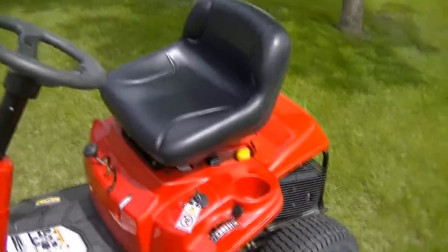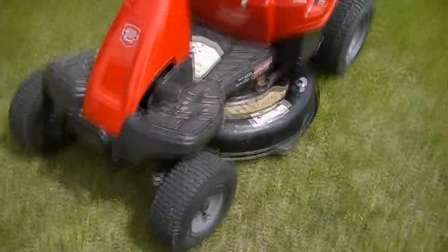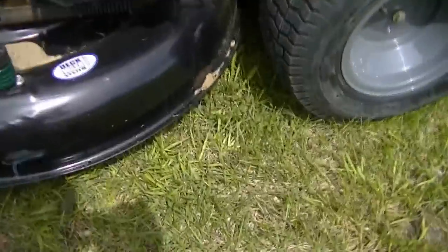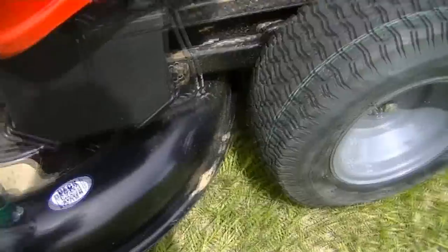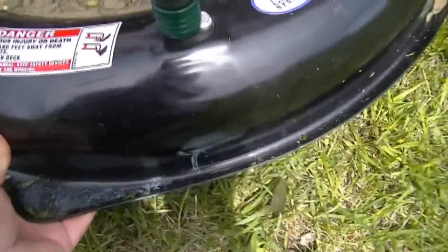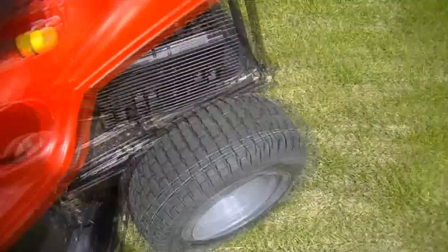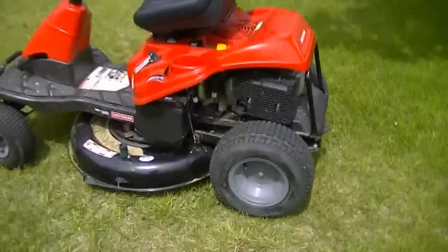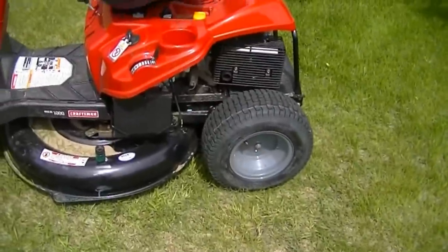So that is it — that's the Sears rear engine mower. The only complaint I have, other than the clutch being a little jumpy, is there are no anti-scalp wheels on the mower. You'll notice that a lot of mowers will have wheels on the side. I'm looking at a way to fabricate something for it, because the mower does float a little bit. Even going up a hill, unless you have really, really flat grass or a pretty flat lawn, you'll see that even mowing in the third position up fairly high, when you crest the top of a hill you will scalp it a little bit. So that is the only disadvantage to the mower — the fact that it doesn't float. But other than that, a very nice machine, and I thank you for watching the video.